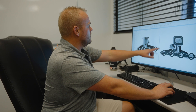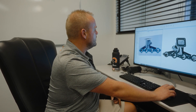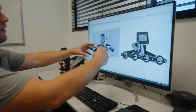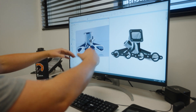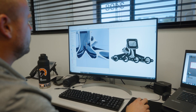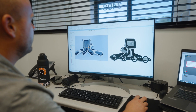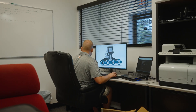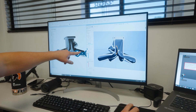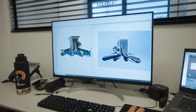Here we're looking at the left side manifold, and if I do a cutaway for you, what you can see is instead of a typical log style manifold where each exhaust runner forms into the next, we've actually divided them out and created an area for them to separate each pulse from the exhaust going up into the turbine. We've done the same design on the right side manifold — it's the exact same lower portion on both manifolds, though this one has to have a turn up on it to fit the turbocharger.